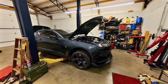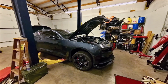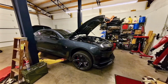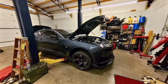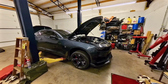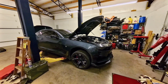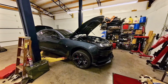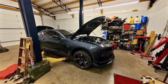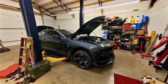ordered a whole new wire harness for the oil pump, which was a pain in the rear to install. I put it back on, and the car started making even more weird noises. I lost probably about 7 PSI of what I would normally see for boost. I've done compression tests, I've done all the things you could think of, checked for boost leaks, and my boost is still down. My compression testing was all fine, leak down was all good. So I'm at the point that either I threw a bearing, or during the new head swap something's not lined up correctly and it just slightly loses air.